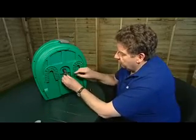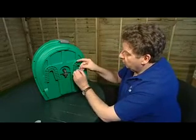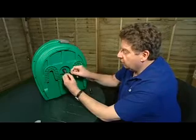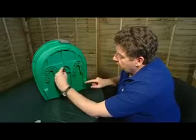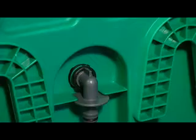If you notice on the end of the shaft there is a little notch. That notch lines up with this square tooth that's in the middle of the clip. So I'm pushing the elbow fully in and then refitting the clip by just pushing it back and then rotating it slowly until it finds its own location and snaps back into place. That's it — job done.